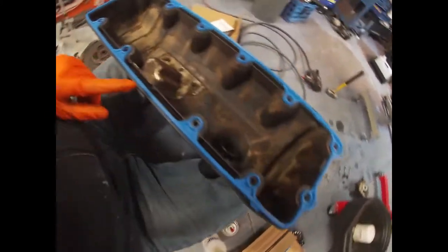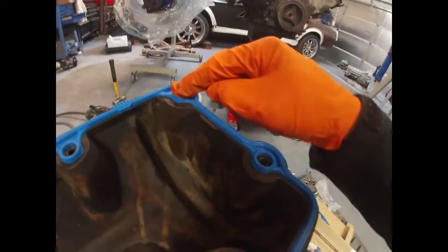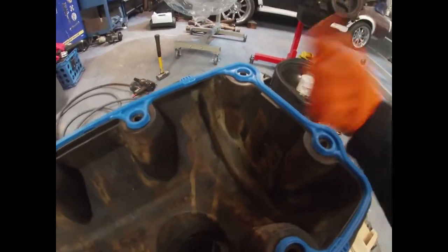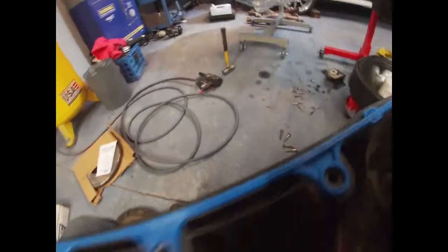All right, put in the valve cover gaskets here. So you just put them on the channel on the valve cover, and then the actual grommets, the metal pieces, they go in through here, and the gasket has 3 little tabs on there that hold it in. So make sure you push that gasket in there. Don't just pop them in, because then this gasket is just gonna push it out. So that's gonna hold it in place.